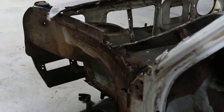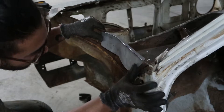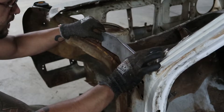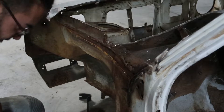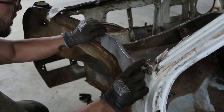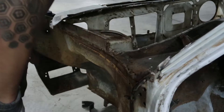This area is only going to get harder to recognise as I tear it apart, so I'll make up this piece while I can. This piece will be slightly altered again once I put things back together, but it's good to know that I've got the general shape down. Regarding the A-pillar, I'm going to try my best to keep it connected to the rest of the body, because I don't want to end up with a wonky car and I don't really want to have to realign it.